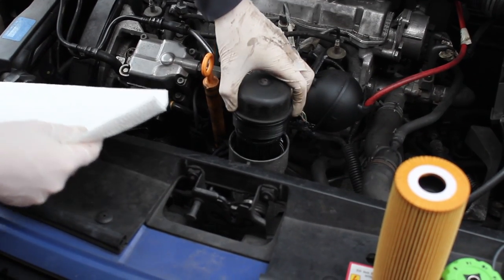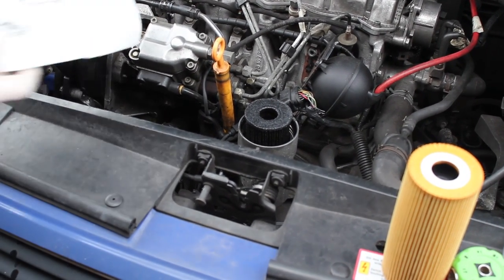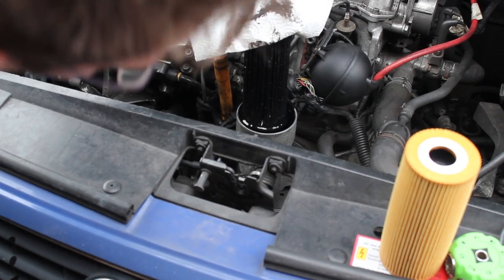So you're going to take your cap out, get a paper towel because it's a bit messy. You're going to grab your old filter out — have a bucket at the ready, and ideally someone that can hold it there for you, because you're going to drip oil everywhere since it didn't drain out with the system.